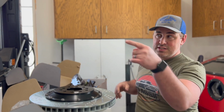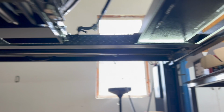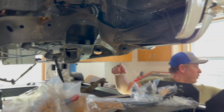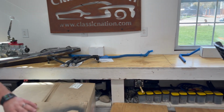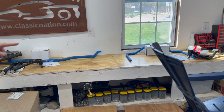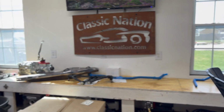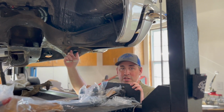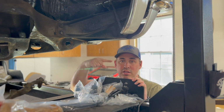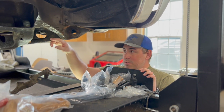That'll be next. You can see the car in the front is completely torn apart. I'm doing new suspension at the same time. New steering. Obviously the coilover kit for the front from Ridetech is all part of the kit that I got. I've got the upper control arms, lower control arms, and coilovers over there. Their kit is actually pretty cool because it replaces and integrates the strut rod. So it does away with the factory strut rod, and you drill 3 new holes in there, mount it, makes it a lot stiffer, just a better setup.